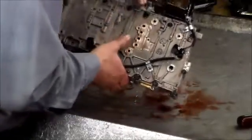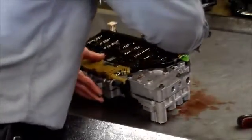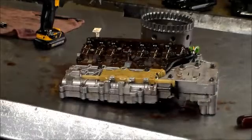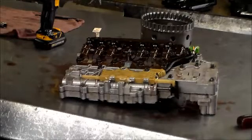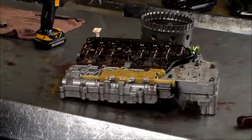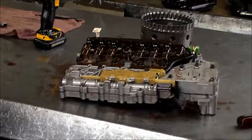And that's pretty much about it for this one. So again, this is a 6L80E valve body. We found the check ball — number one check ball shrunk down, which gave it a neutral condition in drive. I'll be installing this valve body in the morning and giving it a road test. Thanks for watching guys, please subscribe to my channel. Have a good day.